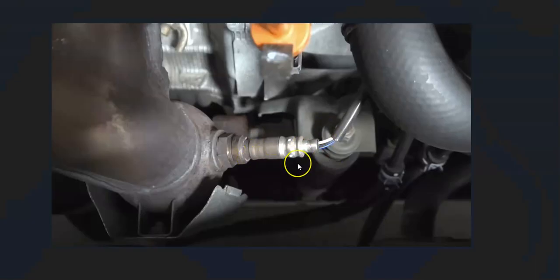Also keep in mind that these sensors are on a fuse. Here's a 2006 Toyota Tacoma — you can see it labeled 'AF Heater' for the oxygen sensors, and this one also has a relay labeled 'AF Heater.' If that fuse blows or that relay goes bad, it could cause issues, so that's something to keep in mind.